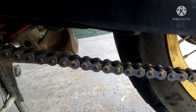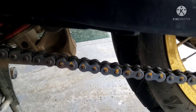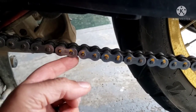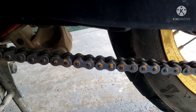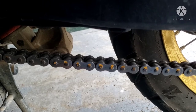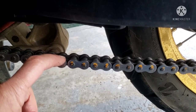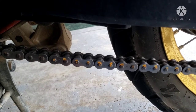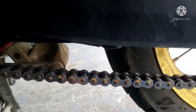The reason you do not want to put kerosene or any type of really harsh detergent on this is because that detergent is going to seep in there between those X-rings and destroy the grease inside. Old habits are hard to break — a lot of people whose dad or grandpa had chains did it that way. But you'll destroy those O-rings with that harsh stuff. Once the O-rings go, the grease inside those bearings will go really fast, and then you've basically got an old-time chain again — it's just going to stretch and be useless in no time.